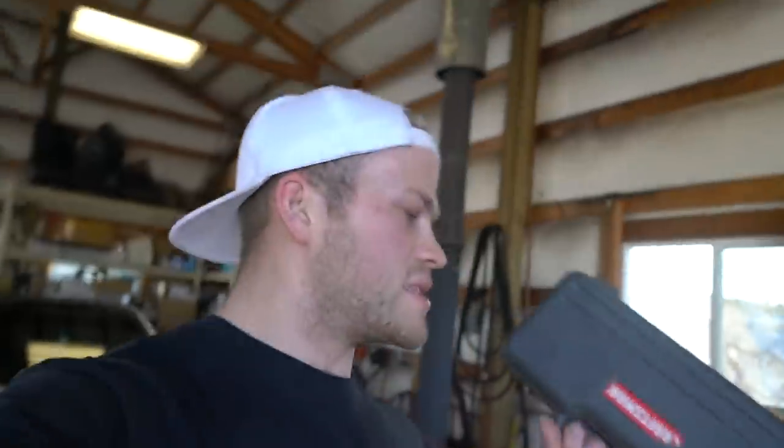I think the first thing I'm going to do is a compression test on the motor. It's very simple to do on the Evo 10 — it'll probably take me like 10 minutes max. That's going to tell me exactly if it's something internally inside the motor, or if it's something like a boost leak somewhere or something else going on.